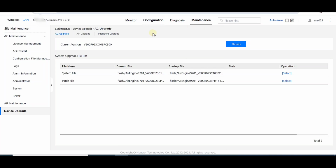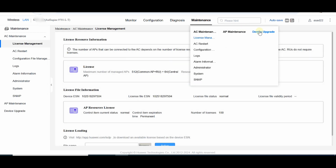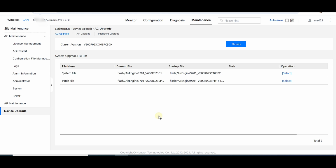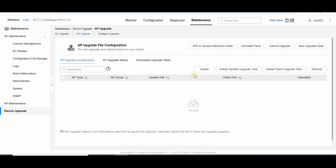Hello guys, in this video we see how to upgrade Huawei AP through Huawei AC. So just go here in controller, maintenance, device upgrade, and here in device upgrade just go in AP upgrade. In AP upgrade select a new task, new upgrade task.